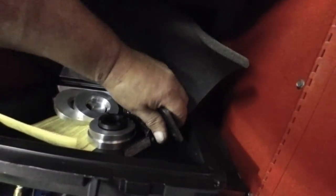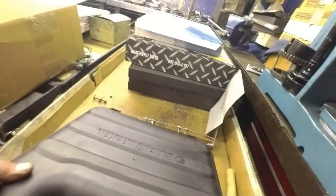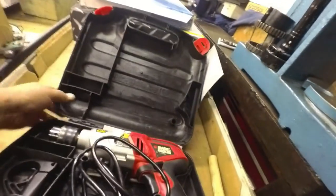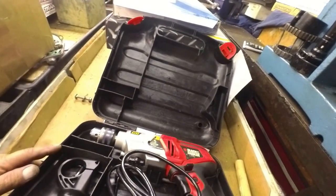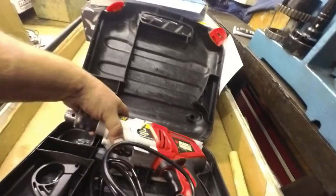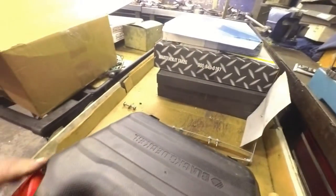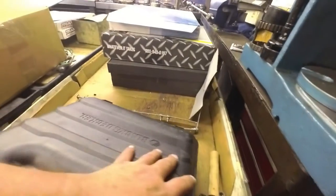Here's some other tools I don't use hardly ever anymore. The 5-pin tool for 440s and 4T60s. Then there's the KM tool — I haven't seen the KM in I can't even remember how long. This is my half-inch drill that I use for doing my reaming. It's a Black and Decker hammer drill — just make sure your setting doesn't go over and stay in the drill part, not the hammer part. It doesn't make for a very pretty ream — that happened to me once by accident.